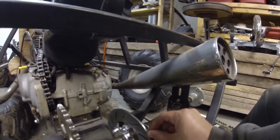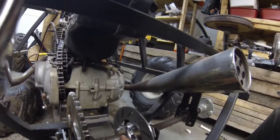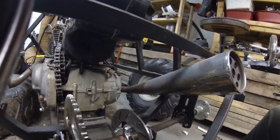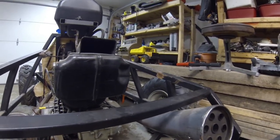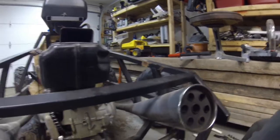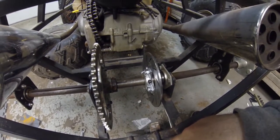And these bolts here, they're not long enough to hit the nylon end of the locking nut. So therefore, it's not a locking nut if the bolt doesn't go through the whole nut to hit the nylon. So I'm probably gonna have to swap those out, which isn't ideal, of course.